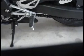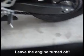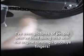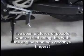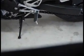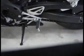And of course, if it's on the swing arm stand, you just turn the wheel this way or that way and let it freely roll, and just hold the brush there and let it pick up the oil, sweeping it back and forth as you're rolling it, and you lube the chain in no time. I usually lube the chain every 500 miles, so for me that's about every 3 weeks, because on a weekend I'll do 100 miles in a day, so 2 weekends is 400 miles, so it's about 3 weeks. So that's it for the chain and the chassis.